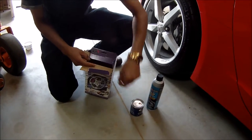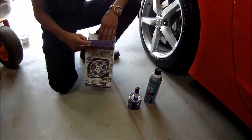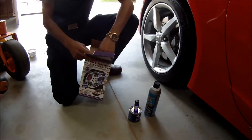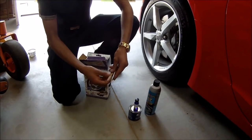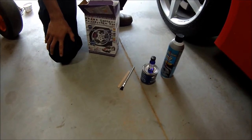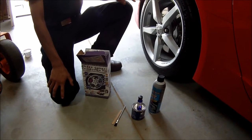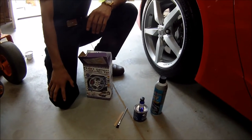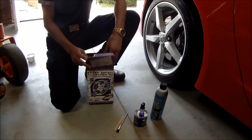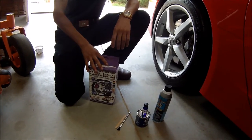The paint has a reactor — this is an epoxy paint so it's resistant to 950 degrees Fahrenheit. It comes with a brush and it's applied using the brush, it's not a spray can or anything like that. So the removal of calipers is not necessary, it's a pretty simple process. First I'm going to raise the car, put it on jack stands, and take the wheels off.